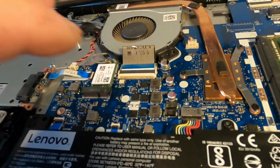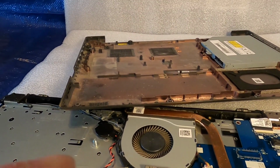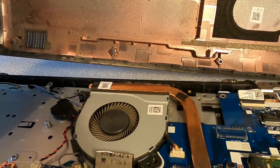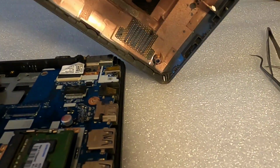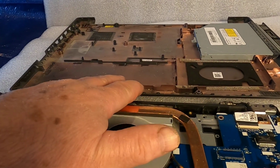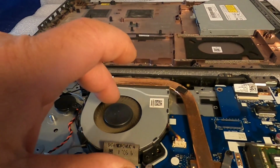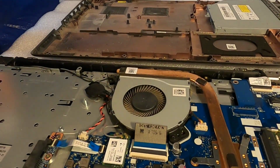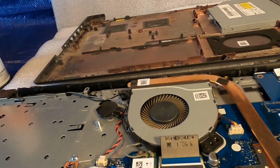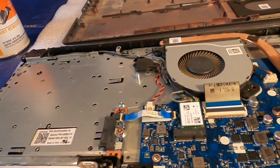Also, another tip, if you've never taken your laptop apart and you had it a few years, this one was taken apart once before. I have a video where I had to put a new keyboard in. Grandson's hit it with a garden hose, and unfortunately it was just a keyboard that was shot. But you can see there's dust particles in here. I'm not sure what this is, but I'm going to blow this out. And I cleaned this out once before when I put that new keyboard in. Also, from time to time, I use the air, the blast away dust on the outside to blow this out, but it still accumulates dust in here. So if you haven't taken it apart for a while and you find your computer getting a little hot, you may want to take this apart carefully, blow it out, and reassemble it again.